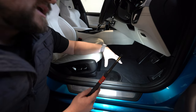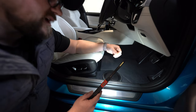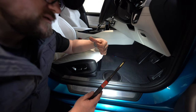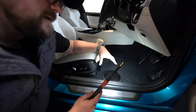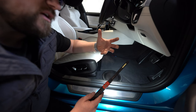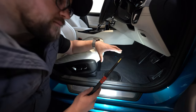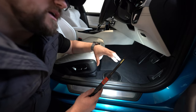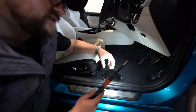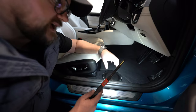And it brings into the mix in a BMW a much smoother transition between the midrange and the 8-inch underseat mid bass, which is completely out of sight. So you get a much richer midrange, like the lower body of vocals and things like that. It all comes back into the system. Of course, you need more amplification, you need more DSP. You can't just add this to your standard system and that's that. So it's like a level 8 upgrade. This is way beyond our standard BMW stuff.